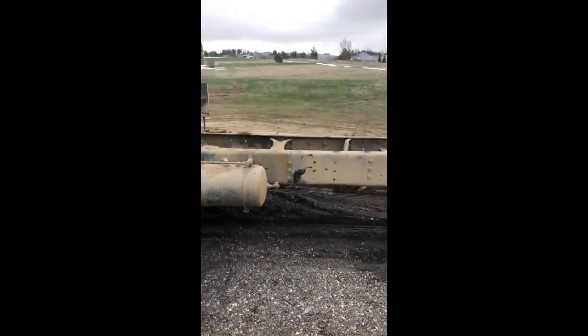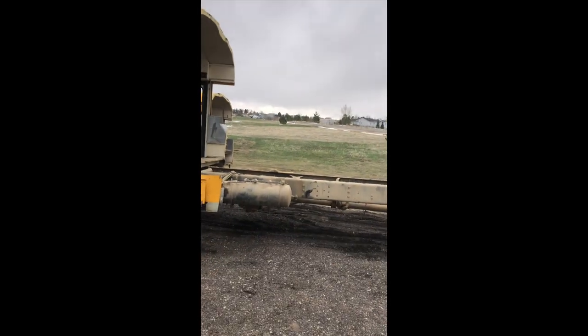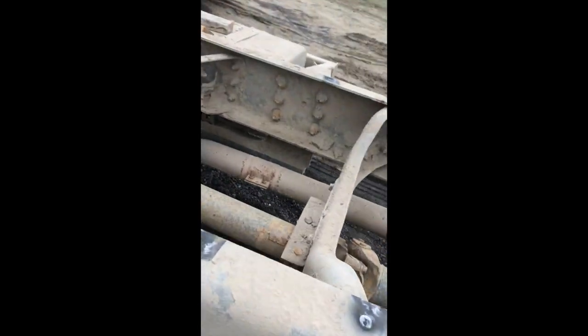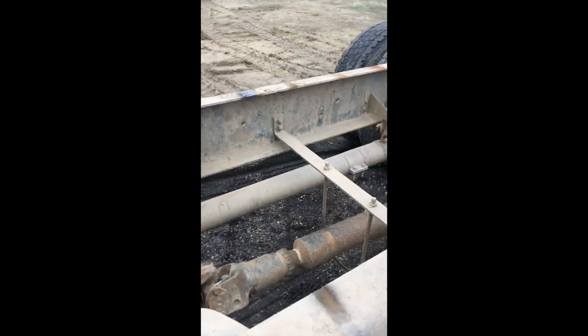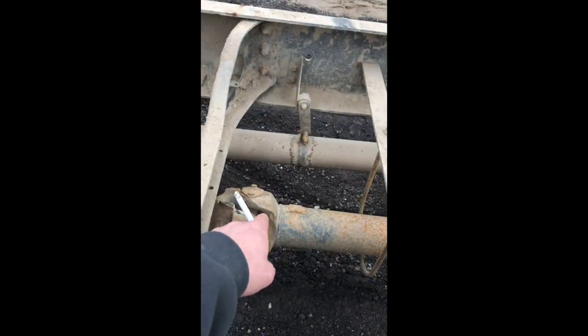That looks to be about, actually that might be about where it needs to be. That's 10 foot or so. So the rear axle perch, that's probably about right. Yeah, so this rear axle perch will come out and probably bolt up right here. Obviously shorten the drive shaft a lot. I'll probably end up taking this off. All these carrier bearings go away. This obviously moves way up here to about where this one's at.